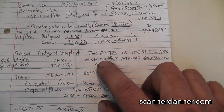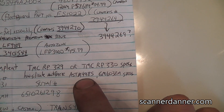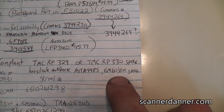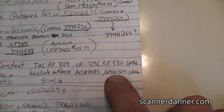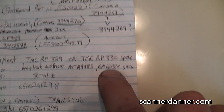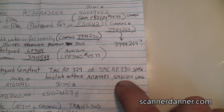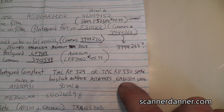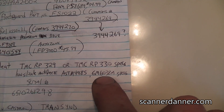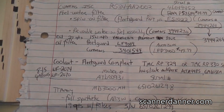I'm assuming that's some type of fleet guard low silicate antifreeze. I did a little digging and there are some other numbers it has to meet: ASTM 4985 or GM 6038M. I found antifreeze at the local parts store that had this number on it — it said 'meets or exceeds' this number and it was just a regular green antifreeze. The antifreeze that was already in here was a mixture of red and green, so the stuff I put in was compatible with both and did have this number.